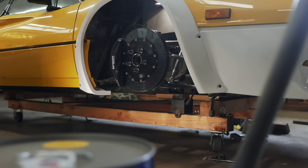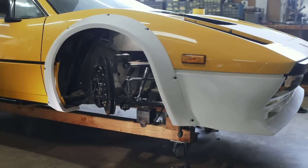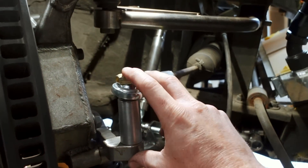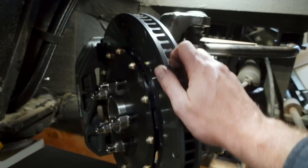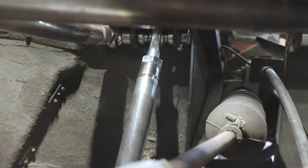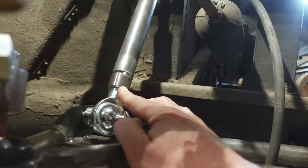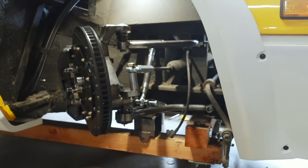I wrapped up the install off-camera, and while we've seen most of these parts on the car before, the exciting part is that for once there's no jack stand underneath them holding them up. The real interesting bits are behind the brake rotor — we have steering, we can actually turn the wheels with the steering wheel. We've got upper and lower control arms, ball joints, everything connected to the spindle, brakes, hubs, rotors, all that. We have our lower coilover mount attached to the factory upper coilover mount, and we can actually adjust the height by just rotating the rod — right-hand and left-hand threads at the top thread in and out for easy height adjustment.